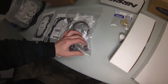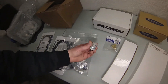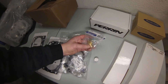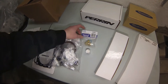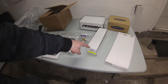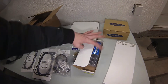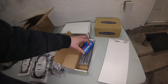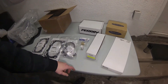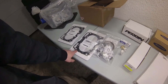Other pieces to go with the block — there's a rear main seal, some wrist pin covers, looks like the top plugs for the oil galleries, probably one of them is an oil feed. There's a magnetic drain plug, and a quick release for the oil drain — I don't really like these but this one is Japan-made. And then we're stepping up the head studs — these are IAG half-inch head studs, a millimeter larger than the stock ARP stud. The cylinder heads actually need to be drilled open one more millimeter to have these pass through.